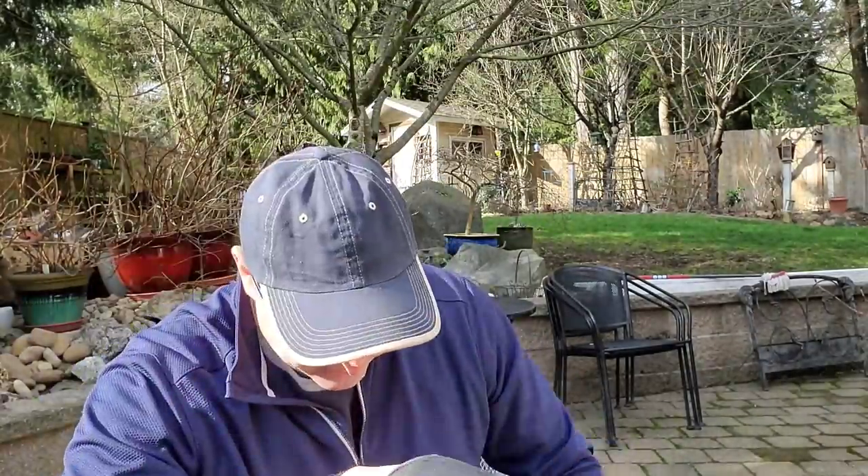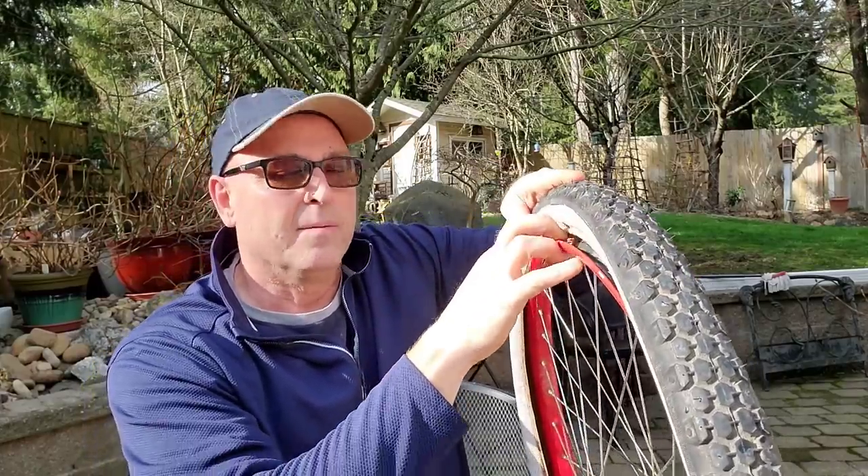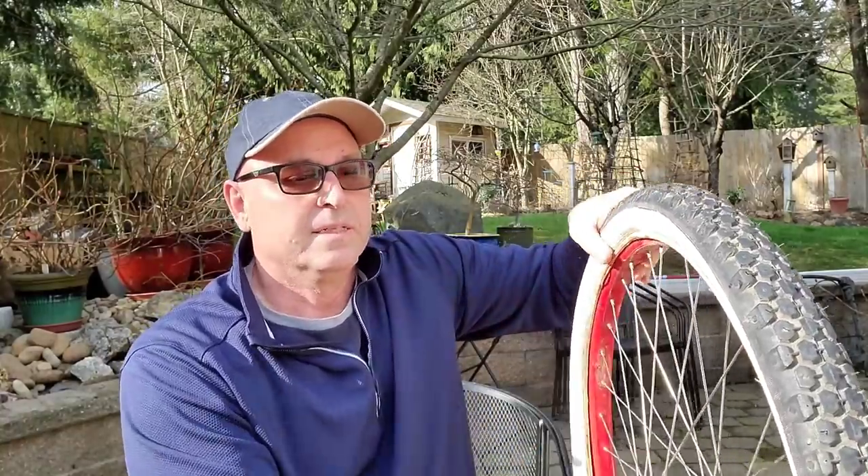When we go to replace this, you want to make sure there's a little bit of air in the new tube. When you get a brand new tube they crunch it down small, so you want to add some air into it — about this much, maybe a little bit less. Also, once you have the old tube out, it's a good habit to run your fingers along the inside of the tire or just pull it back and look inside, just to double-check that there's not something that's going to pop it again.